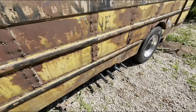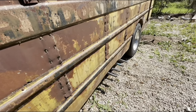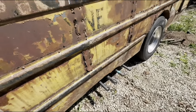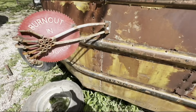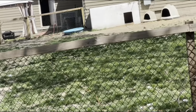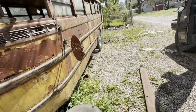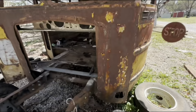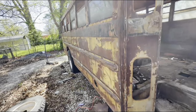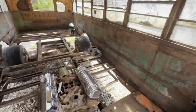All right, so this pipe is kind of tacked in place where it needs to be. I'll bring it up to the shop whenever I can and weld it a little bit better. This flux gun is not handling 300 foot of extension cord. So what we're gonna do is get the other side kind of where we want it, square it up. Once it is squared up, then we'll take these headers off.